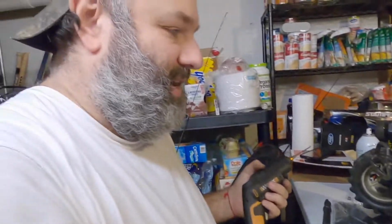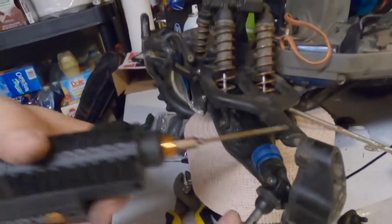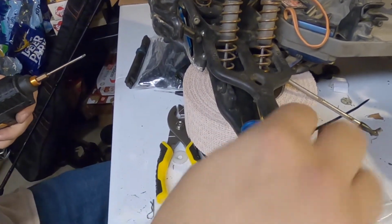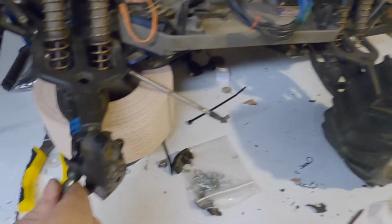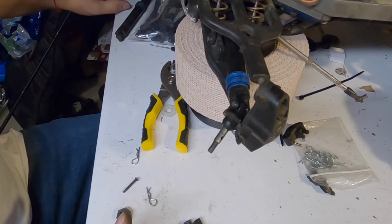Now, for anyone who knows anything about these things, believe it or not, these things here, when your wheels cock this way, towed in this way, these little things here control your camber and your toeing, along with the rod. It adjusts how far the wheel goes in, goes out, and by just moving these slightly, you can manipulate this whole wheel. The cock in, go back, turn this way.